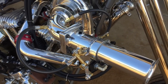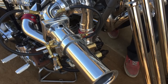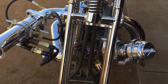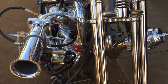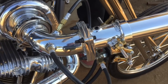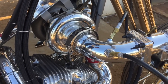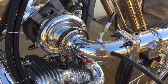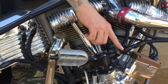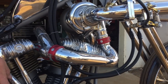And then you put Hilborn on it? Yeah, it's mechanical Hilborn injection with a draw-through turbo setup, so it's got a T3/T4 style turbo. Have you worked with these components before on cars? Yeah, I'm pretty familiar with them. I helped my buddy Rick out quite a bit with his last bike that he built, and they got it together — the hard stuff's done. You just have to work with them and tell them what you're doing. I had them set it up for seven pounds of boost. And I got the new upgraded billet fuel pump, the cutoff switch for the fuel, all the number 12 injector nozzles and all that stuff. I had them set it up for all their newer stuff that they've been building and producing lately.